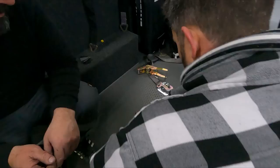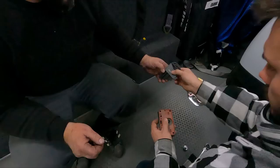So boost the fuel curve, and then these little guys are adjustable. Okay, where's the little Allens? Where's the bag of the things? In the trailer. And you change these guys out, and they enrich it more or less.